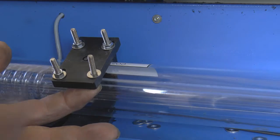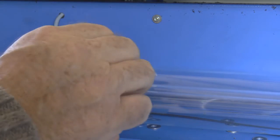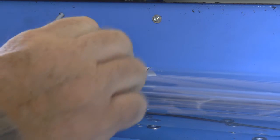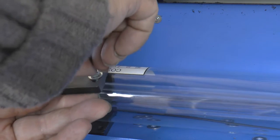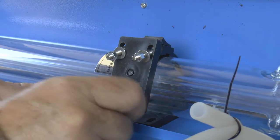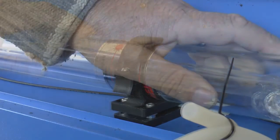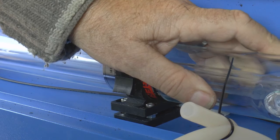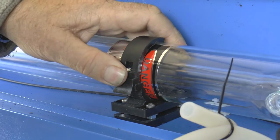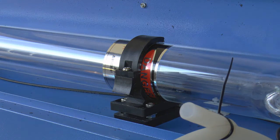What I'm going to do is put in a washer, then a nut, and do the nut up just slightly looser than finger tight so that the whole assembly will slide backwards and forwards in the slots. I'll do the same at the other end — putting the nuts on loosely first, because the screws will have a tendency to fall out if I'm not careful. Once the nuts are on I can tighten them up to the right degree of tension and pop those through the holes. Looking at that, they're still slightly high on the mirror — but having said that, they must be where they were before; the centre must be on the same point as it was before. So we'll carry on and leave it like that. I've put the nuts back, finger tight, and that will hold the screws upright.